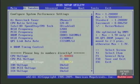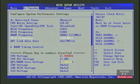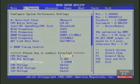Once you have your final maximum stable settings, you need to think about a few things. Did you have to increase the voltage a little too much to get that 0.1 GHz speed improvement? Are the temperatures a little above the recommended levels? Is that 0.1 GHz speed improvement worth shaving off a year of your CPU's life, or having your CPU fan spin too fast making your computer noisier? In my case, I'm going to lower the CPU speed down to 3.7 GHz. It required only a 0.05 V increase of the CPU voltage from the stock setting to run stable at that speed, and with the new cooler, the load temperatures were in the low 70s.